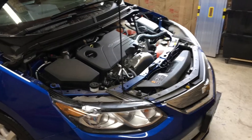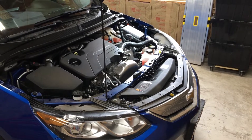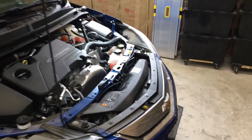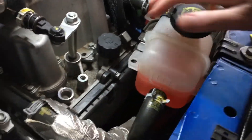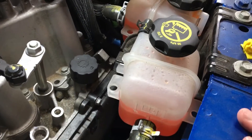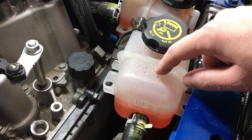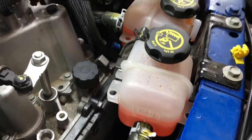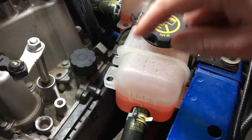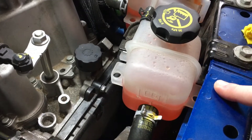I'm going to show you today how to check if your battery coolant is leaking internally before you take it to the dealer. The other day I noticed on my Gen 2 Volt that my coolant was a little low — about 7 ounces low. I topped it back off and cleared the codes because I threw a code for low coolant. I've been checking it and it hasn't dropped yet, but I'm definitely concerned it could possibly be leaking inside the battery, so we're going to check that.